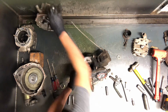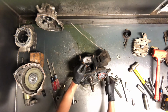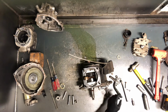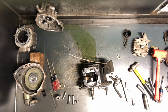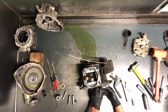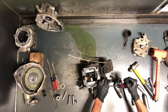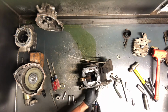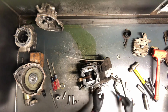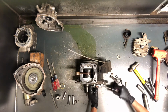And we've got your oil pump behind there. And then this gear, we may need to pull. Sometimes they come off fairly easily. We'll see how easy this one comes apart. Got a 10mm nut holding that impeller on. This impeller will just slide off of there, but it's sealed up pretty good, so you want to be careful you don't damage it pulling it off. Just pry on it a little bit from either side, and then obviously replace that seal.